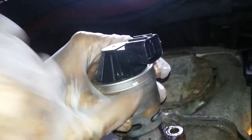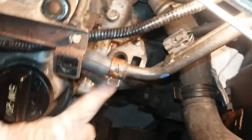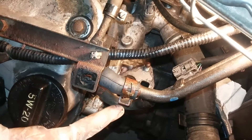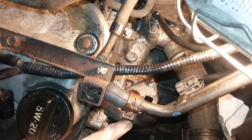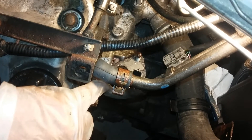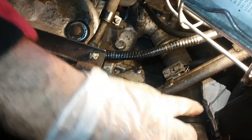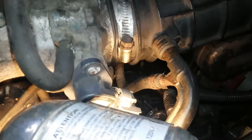Okay, so to replace it, put the new one in and tighten it securely. One thing to note — this hose, the lower one, this little rubber hose here is actually a radiator hose. Coolant is flowing through this one. Because it's very close to the EGR and the engine, it heats up and cracks often. So it's very important to replace this piece of hose with a radiator hose — don't use a vacuum hose, this is not a vacuum line, this is a radiator coolant line. You can replace this hose as well as the other end of it right here. The top one is an air line going to the intake and this one is coolant, so you can replace these two with two new clips.